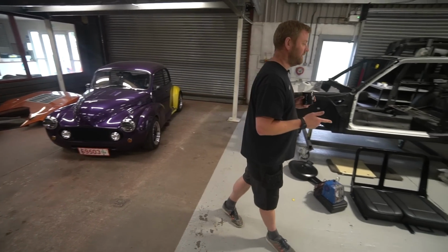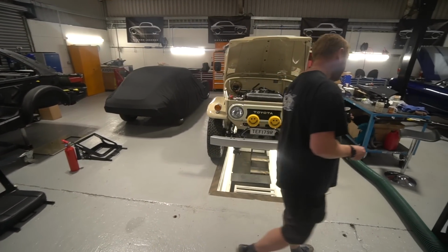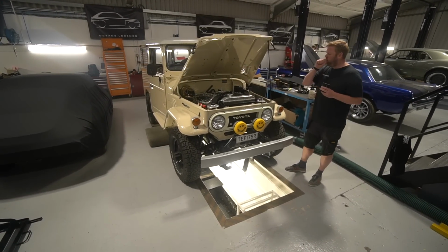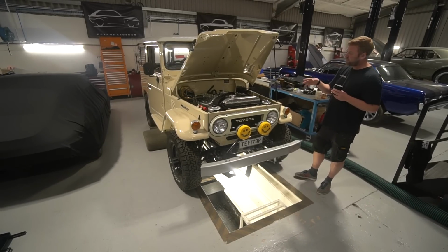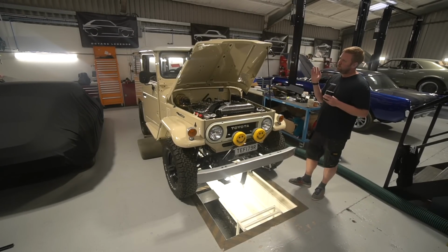And then a Land Cruiser, which has had the dreaded engine squeak for a long while. Now, we mentioned this quite a long while ago, and we were mulling over whether it was something to do with the cam belt train. It sounded kind of like a belt squeak. We ran it without the auxiliary belt. Didn't solve it.